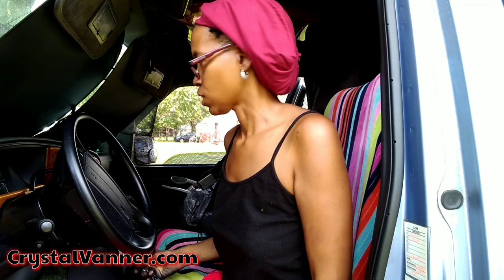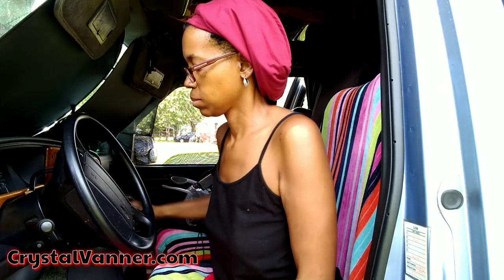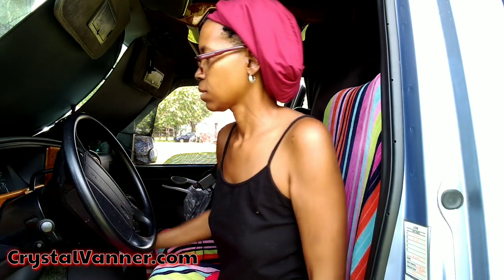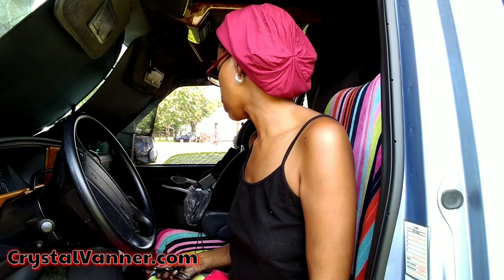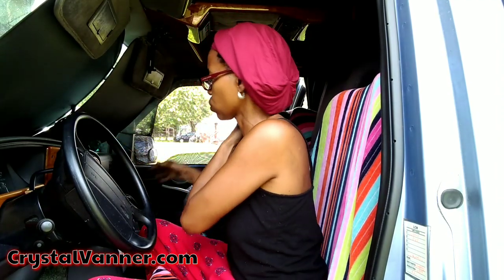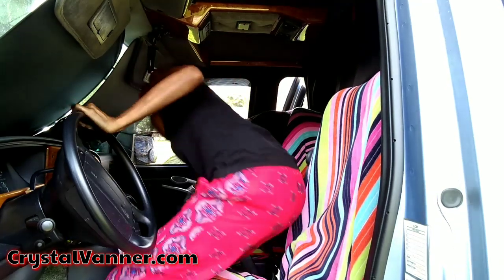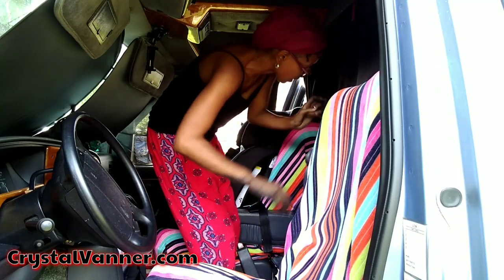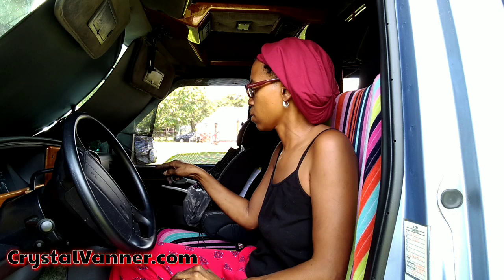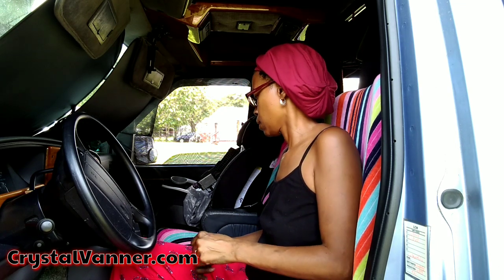It's not starting. The battery? It shouldn't be — it's a brand new battery. Try it again. The lights came on, everything's coming on. Yeah, that's the battery. I'll get the booster box. It's a brand new battery and it's stayed on. You know what, I can't with this van. I have a little solar panel in the windshield connected to the cigarette lighter that's supposed to trickle charge into the starter battery, but I'm going to have to get another battery. I've taken the bulbs out of the lights that were staying on when the side door was open. I don't know what else to do.